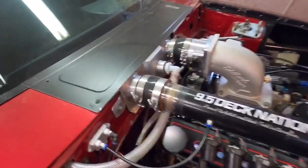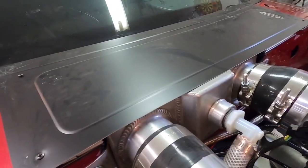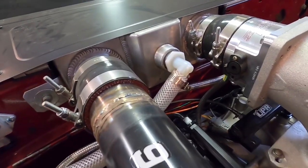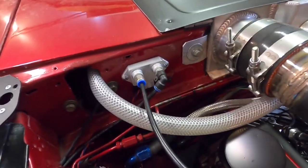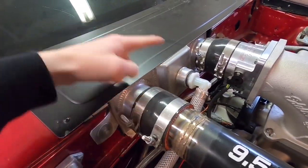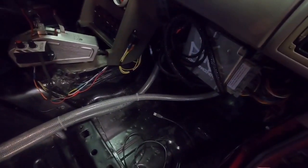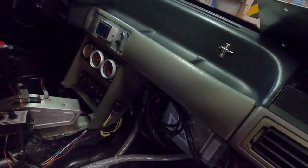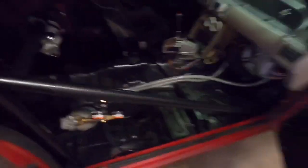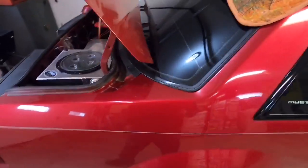Obviously you're not going to get any airflow over this cooler because it's not designed that way — it's designed to be cooled by liquid. That's what these hoses are for. Maybe you've seen them in my car: there's a hose on each side of the cooler circulating coolant constantly through it. A couple guys asked if these were fuel lines — they are not fuel lines, they are water lines going to the intercooler under my dash. You never want to run fuel lines exposed inside your car; that would be very dangerous.